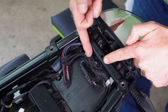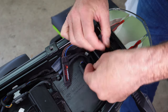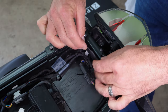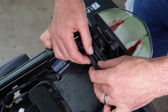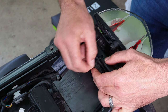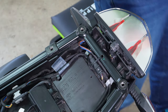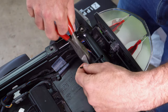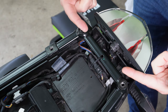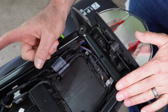We've got our connection back in and our module in place. Now use a cable tie through the subframe to secure everything, with the Visor Tech module positioned in the middle. It doesn't need to be really tight — just enough to stop it moving around — then cut off the excess. That's it — three wires connected, socket pushed back in firmly, cable tie refitted.